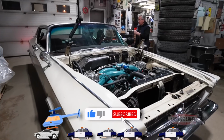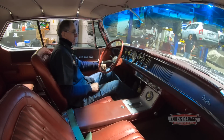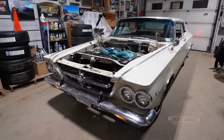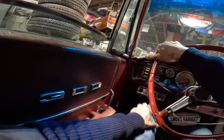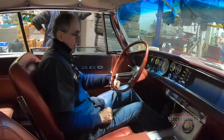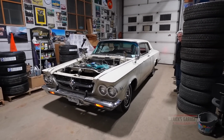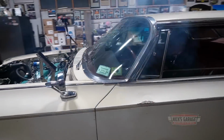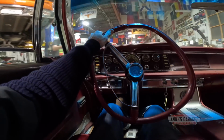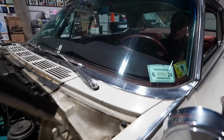You know what it is? You got highway gears in the back. Yeah. I got no stall speed. That's true. I got no stall speed. You know what? You got to bring up the RPM slowly. Yeah. I can't make it at a dead stop. How about if I torque it up? Torque it up, buddy. Torque it up. Here we go. Nope, this is not gonna work.